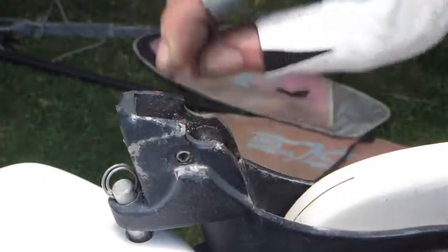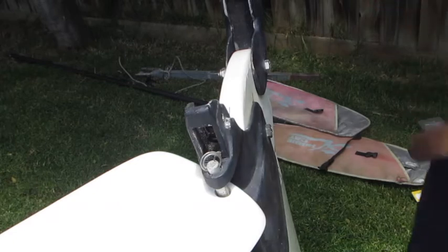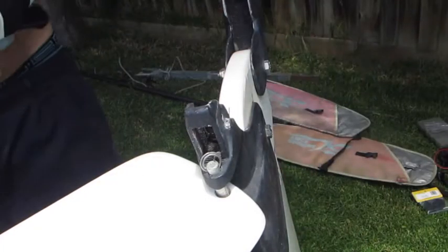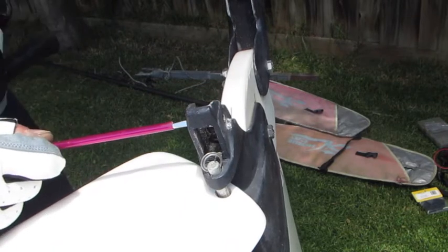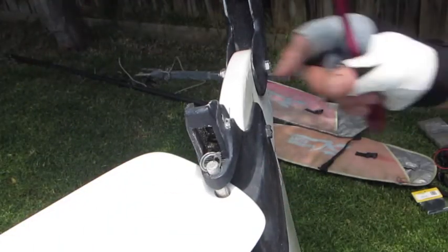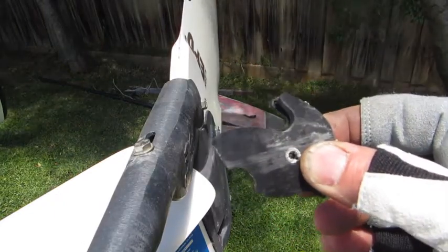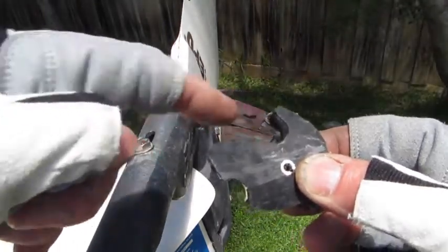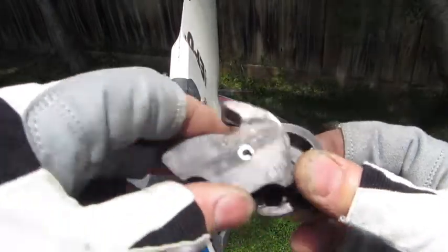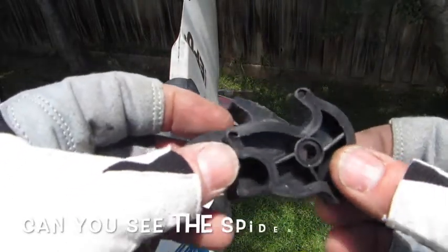Blow all the spider webs out of it. Now we're going to attempt to remove the other parts of the roll pins. With a little bit of persuasion you can knock these pins out and they come out pretty easy — no damage to the castings. I've got the old cam here and you can see the finger on it is bent back a little bit, it's not as tight as the brand new one. The gaps have opened up, which causes your rudders to not click up and down properly.